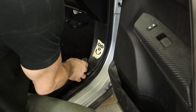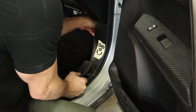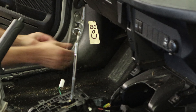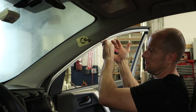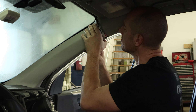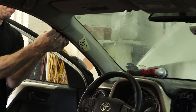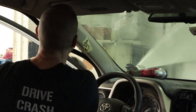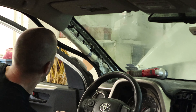I'm going to pull the sill plate up so we can get to our kick panel — it's got one little thumb screw on the back. I'll do the driver's side. It didn't have a thumb screw on the back. I'll do the A-pillar trim, pop it out of there. Then you've got to twist the clips 90 degrees and it pops out. Putting them in is a little different, we'll do that later. So rotate the clip, pop it out, same thing on the bottom. That's so when the airbag deploys those trim pieces don't go flying across the car.